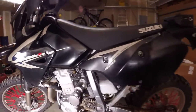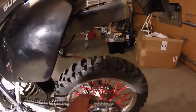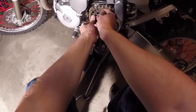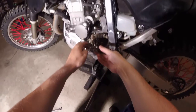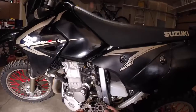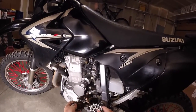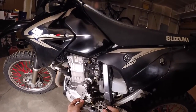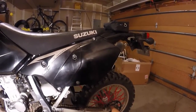Got the wheel loose, so now I'll get this chain off the sprocket. What I find easier is just taking the chain off the back first. When you pull it off, remember the flat side goes out and the non-flat side goes in — there's a big difference. Every time you go down one tooth on the front, that's like going up three teeth in the back. So this one's got 15, the new one's got 13 — that'd be like putting a 50 on the back, since it's currently a 44.